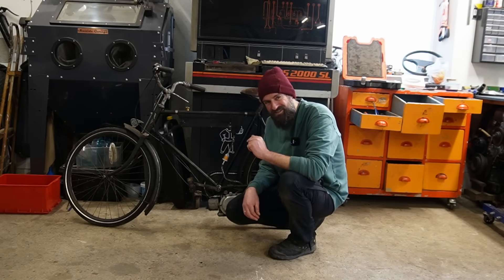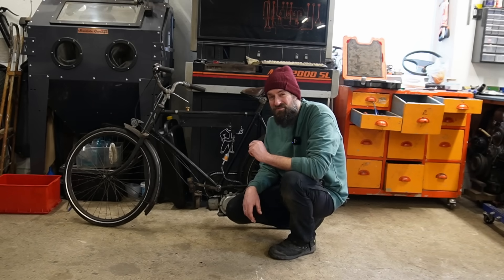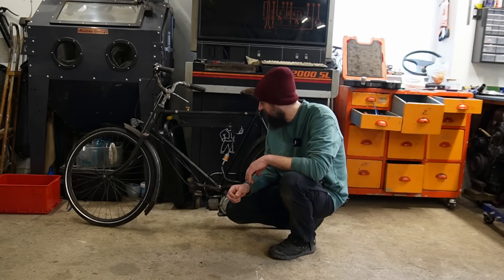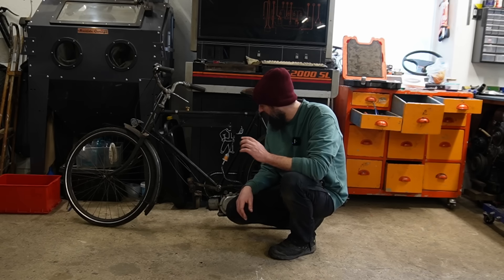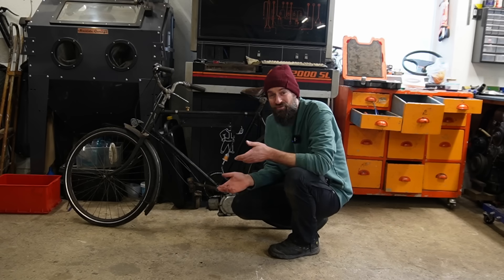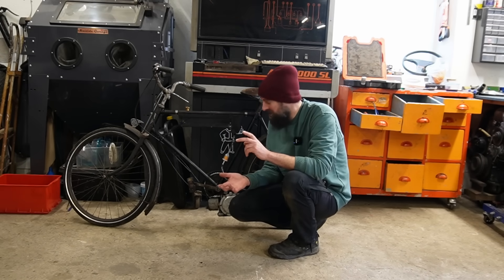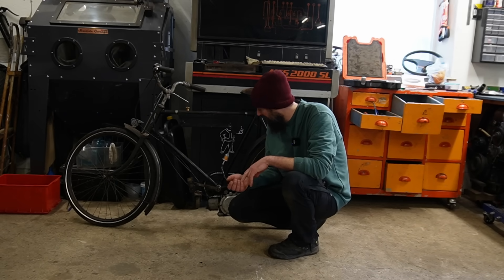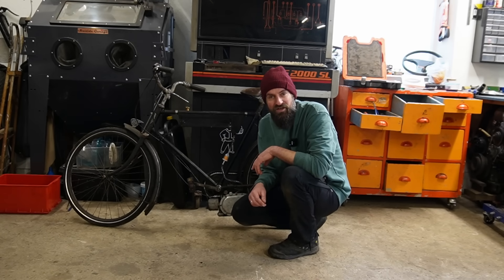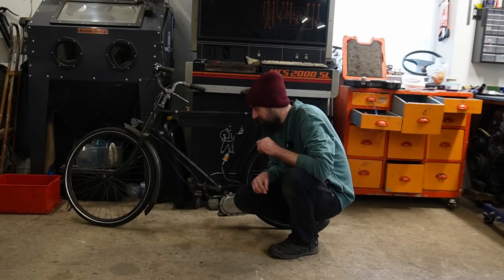It's an 18cc, so it's not going to produce a lot of power. It's also interesting that it's running pretty much slightly better than the previous attempt on my own blended fuel. My own blended fuel was a completely different viscosity, and it needed some altering to the needle — but other than that, that points towards the key thing about this engine: it's actually not a diesel engine, it's a multi-fuel engine. You can use a lot of different fuels. If this were a good engine, it would have been very popular because it would be very cheap to run and very versatile. I cannot really see why the two-stroke engine got so popular if this was a good design — and it probably isn't. But it's a very interesting thing, and it's a lot of fun to experiment with.